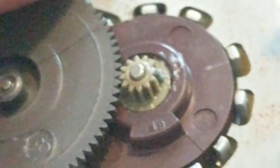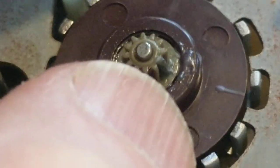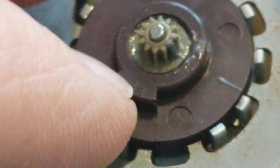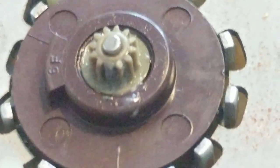After breaking the teeth I said, 'well, this is probably toast.' But I later discovered I could take the small gear out, and once out it rotated rather easily — though at the time it hadn't. I concluded the only problem had been some corrosion locking up the spindle axis. I thought if I could get those two teeth back on, maybe I could get it working.